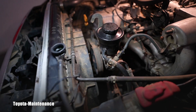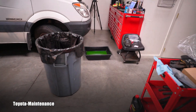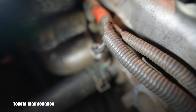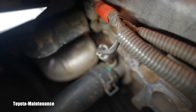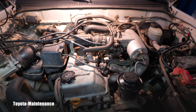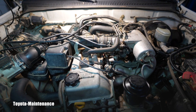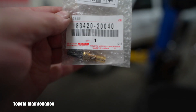We are replacing the green coolant — it's already gone down there, you can probably see it. Because the coolant is out, I will be replacing this sending unit, the sensor for the gauge. They call it a coolant temperature sensor for the gauge, but there is another coolant temperature sensor on this engine in a famously bad location that is difficult to replace.